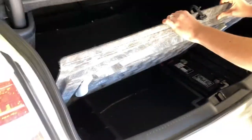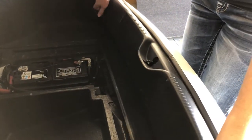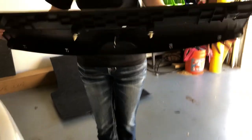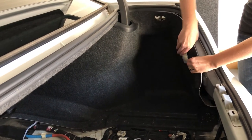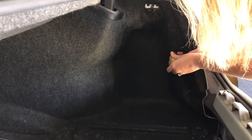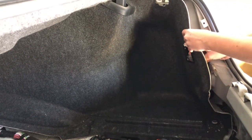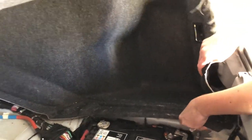After you get the rivets and the grommets out, you'll have to pull this trunk liner out — it's pretty easy to do. This rear plastic panel in the back is held on by several clips. Pull it from the bottom first, then pull it directly up. There are a couple of clips on the front side and a few on the top side. You may have a model that has rivets here instead of clips — if so, you'll just need to pop those rivets out. Now we can go ahead and pull back the carpet wall, pop the light out, and punch it through so you can pull it back. Remember to undo the rivet at the top by the bar or you won't be able to pull the carpet out from around the bar.